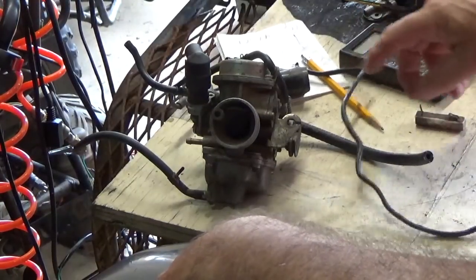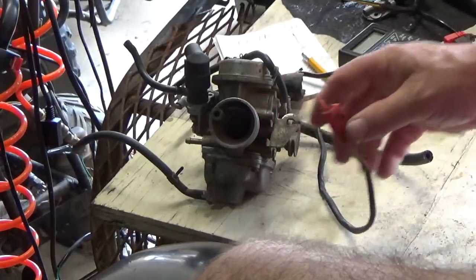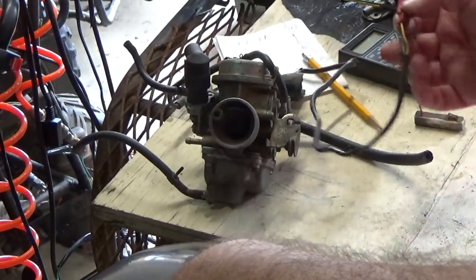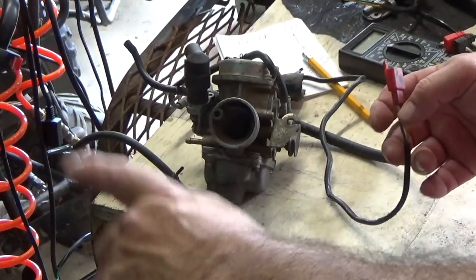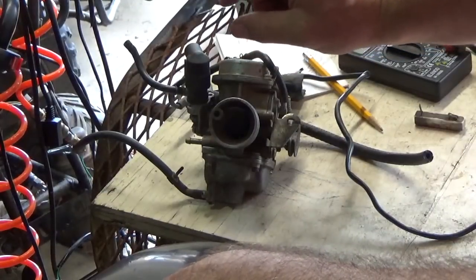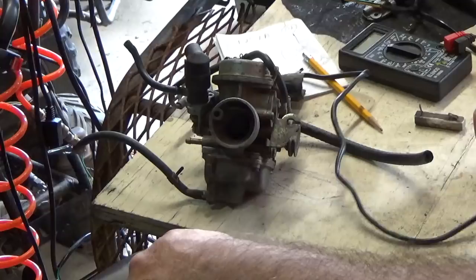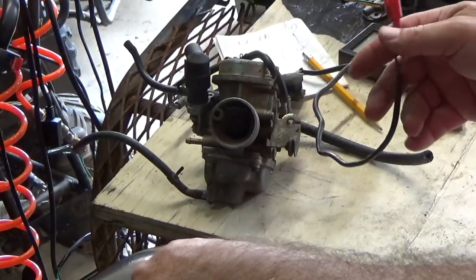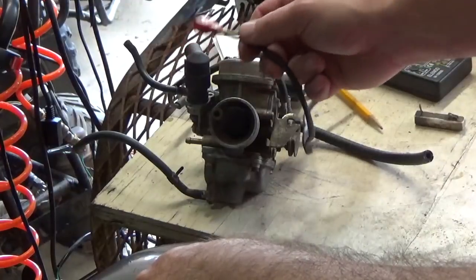Here's how to test them - a quick and dirty test: unplug the cable, do a quick ohmmeter check, and you should get somewhere between 20 and 35 ohms. That indicates your heater is working. It doesn't mean it's mechanically opening and closing or that it's not stuck, but it means the resistance in your heater is good.